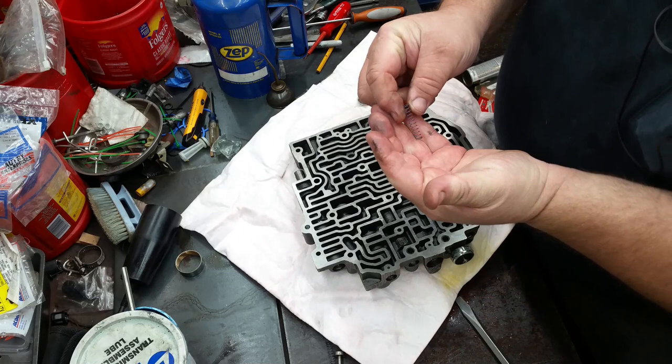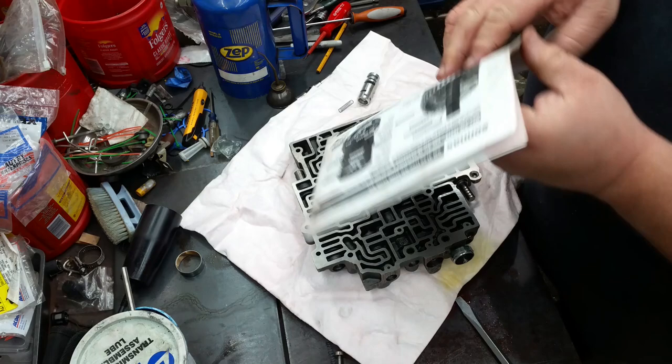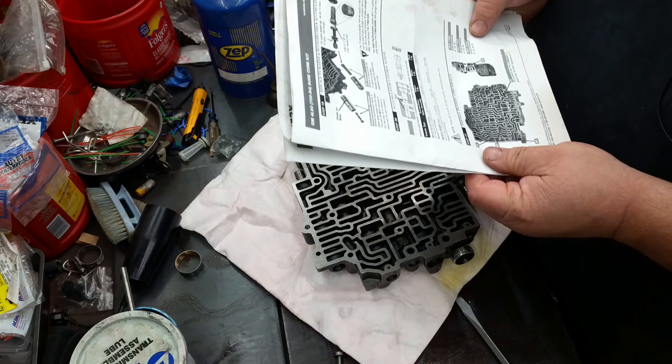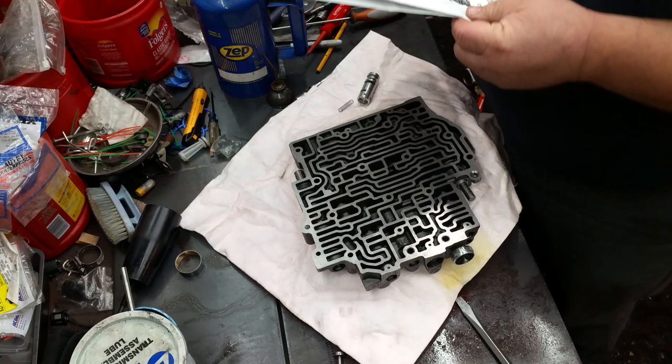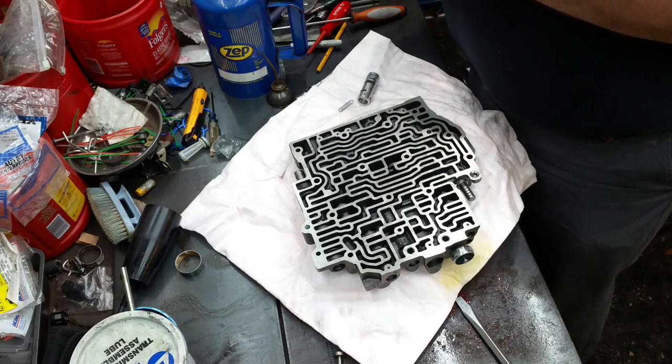All right. Now, according to the chart here on Sonnax, pink is for heavy cars and trucks, 308, 323, 342 gear, and the pink is a firm shift. Well, I'd say, being as this is a Camaro, I would prefer it to be a firm shift. All this stuff is changeable once it's in the car.